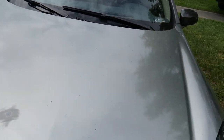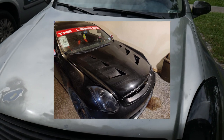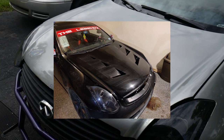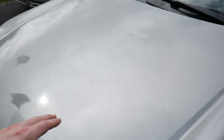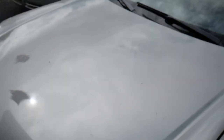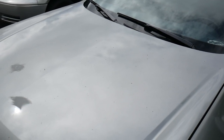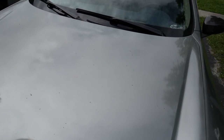We're going to try to do this with our cutoff wheel, basically measuring and taping off the areas where we want to cut. My buddy Javier on Instagram actually did this on his G35 and it came out really good. Obviously this is going to mess up the structural rigidity of the hood, so it might make it a little bit more unsafe. It's also going to ruin the paint and you're going to want to get your hood repainted afterwards where we're cutting the vents, exposing bare metal that could rust if not primed and painted.